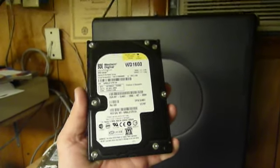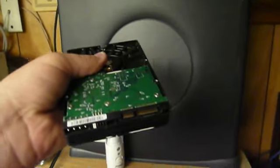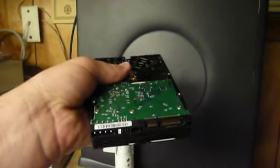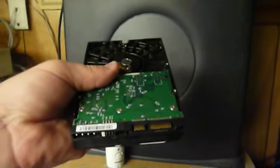This old 160 gigabyte hard drive is actually a serial ATA design. The Dimension 8300 is an old enough machine that although it didn't sell initially with serial ATA drives, the connectors were there on the motherboard, and toward the end of the model's life, before they replaced it with the 8400, Dell did offer machines with serial ATA drives pre-installed.